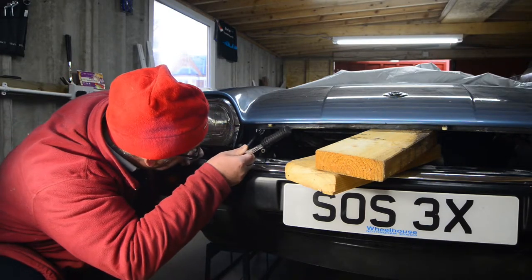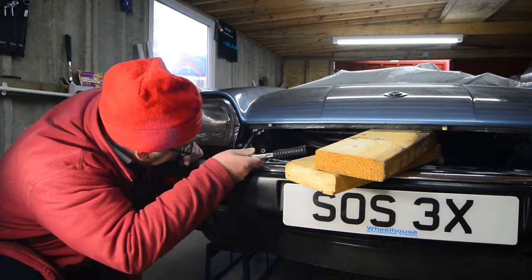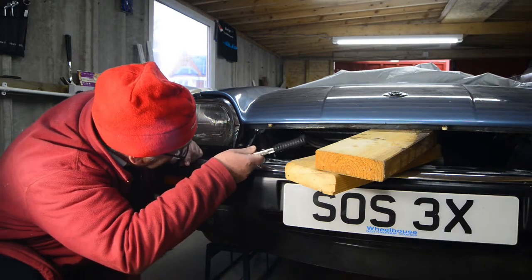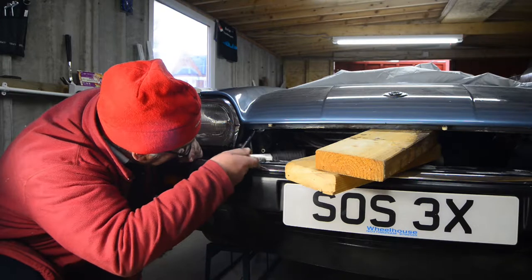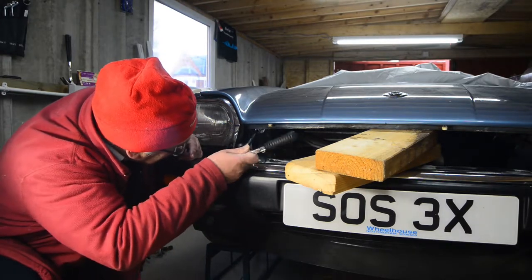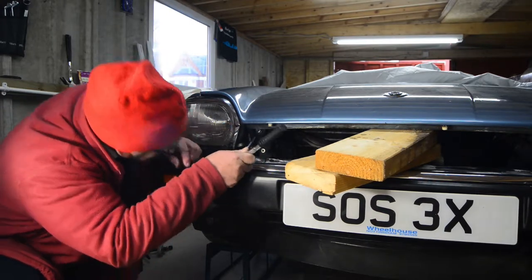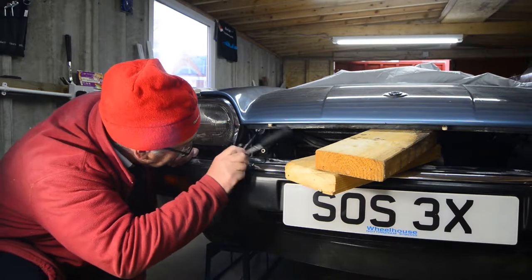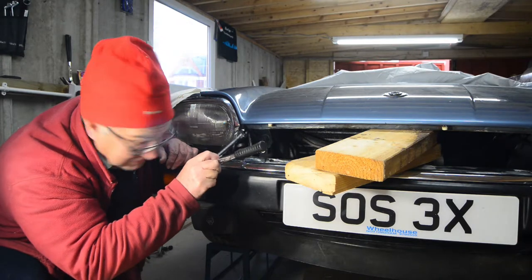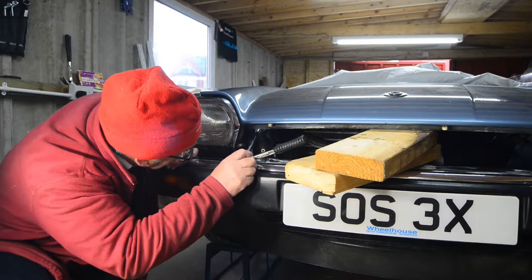See what we're doing? So there's your answer for any awkward bolts, nuts you can't get at very easily. Use a crow's foot spanner, which hopefully you can see I'd already done it, slacked it off before, but not before marking where the bolt and the washer head is, otherwise it won't go in properly when you do it again, or you won't line the bonnet up properly.